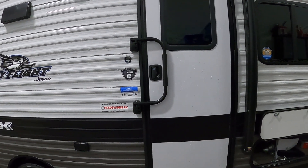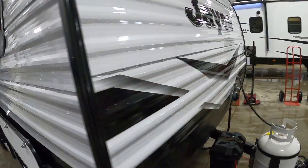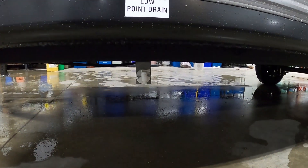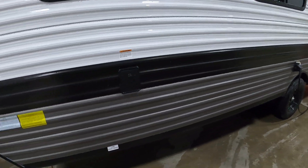If we are out boondocking, we're going to come over here, get underneath our fresh water tank, and dump that low point drain there. Empty the fresh water, bring up your stabilizer jacks, and head on home or to the nearest dump station — whatever you're in need of.